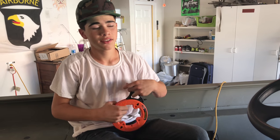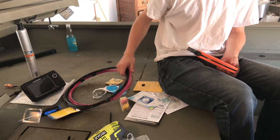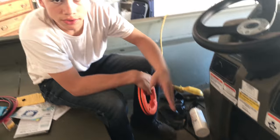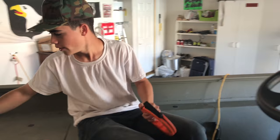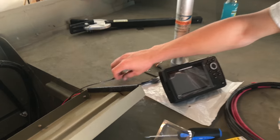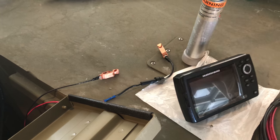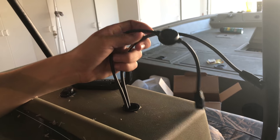So this is actually taking a lot longer than we had planned for and we actually had to buy some extra wires and things to run, because we had to run the wires all the way through the bottom of our boat to the back. These flat bottom boats don't open up for you to do that. We hooked this up in the back and we had to get a 3 amp fuse right there so if anything ever happens it doesn't blow out our fish finder. It's working out but it's taking a while.